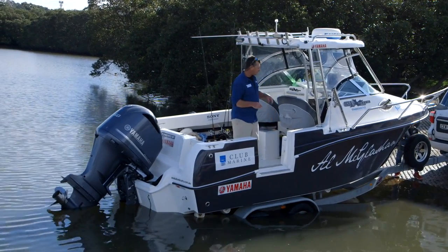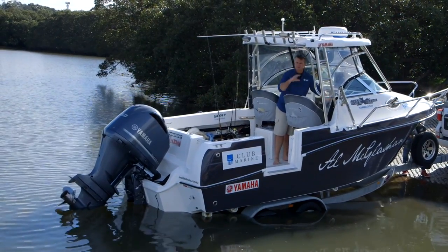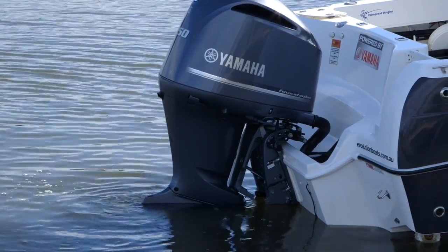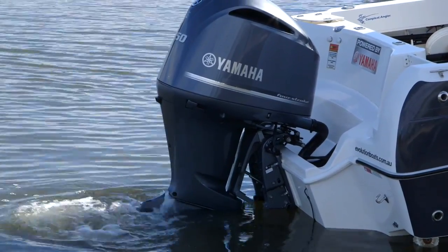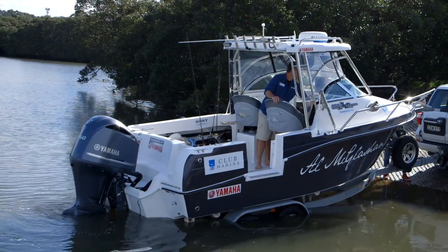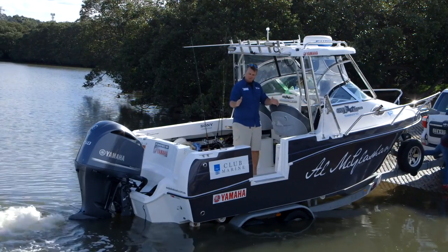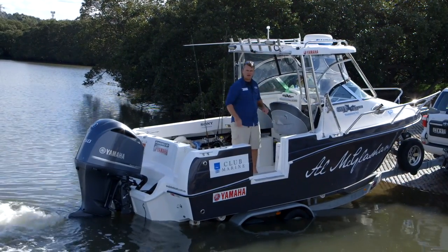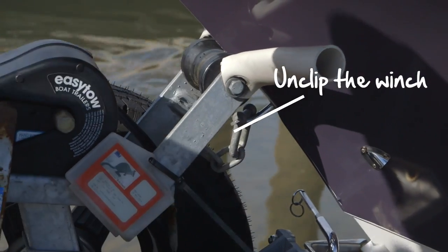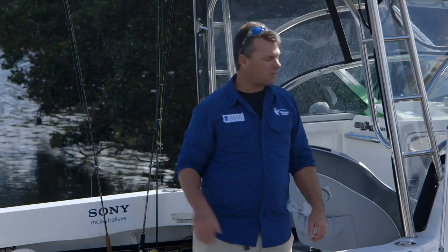What I'm going to do as a safety precaution is trim the engine in. Don't trim it too far because you don't want to touch the bottom, so take a note of how deep it is. Get her in just so she's underwater, start her up, and let Millsy know that I'm putting it into gear — he's got to keep his hands away at that time. What the boat will do is it'll hold me sitting on the trailer. Then I'm going to unclip the winch, the safety, and open my boat catch. So now we've got the engine running and she's unclipped.